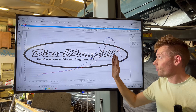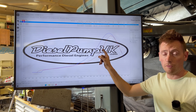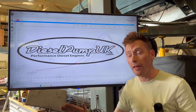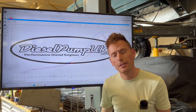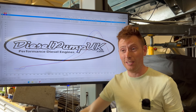Look at this — that is the difference between quick spool valve and no quick spool valve on an S300. That is the difference. So the people that say it doesn't make a difference, doesn't work — that is the difference right there. Notice also that the power is high and then falls — that actually does make sense, because the turbo was so laggy and so late.